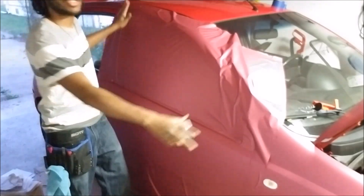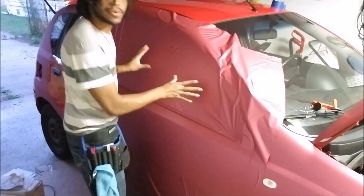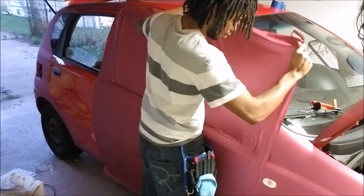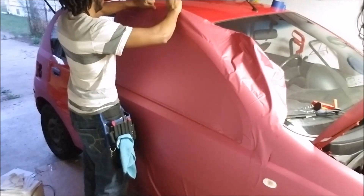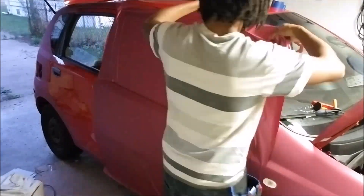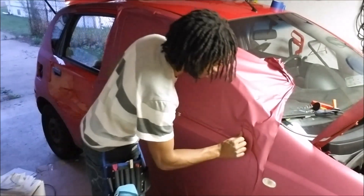Nice, now there's no air in there. For this entire section I know there's going to be a lot of bunched-up film because I started right here and worked my way over, but luckily I can use the empty space where the window is to push some of the film inside there, which will give me fewer lines and wrinkles — but I think I might not have to do that. I'm going to give it a nice stretch to get over that, then lift this part up once again and stretch. For all these deep recesses I'm putting a lot of pressure with my fingers to make sure there's no air stuck behind it, because that will cause it to fail.